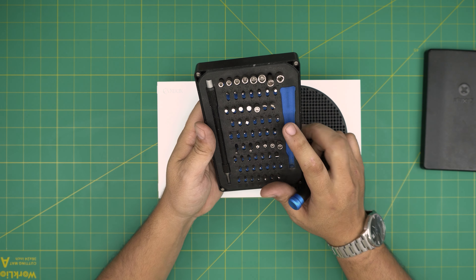Now we have the fan and the power unit visible. Grab the power unit and pull it straight upward. Don't touch the thermal putty in there. Grab the fan system, pull the cable jack straight upward, and set it to one side. Now we're going to remove the screws on the side panels — these are the same screws as the X-clamp on the bottom, so don't worry about mismatching them.